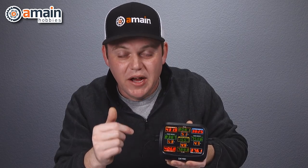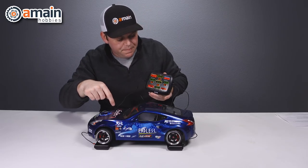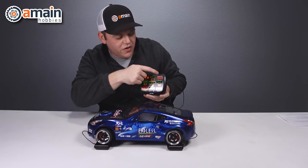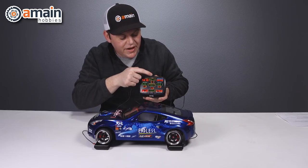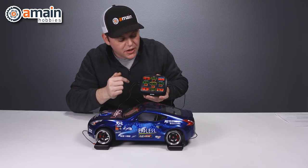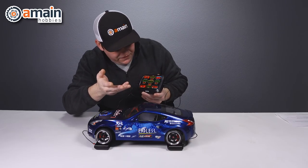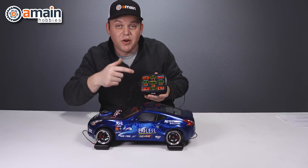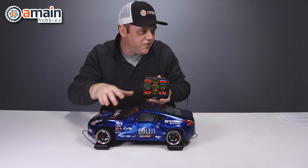As you can see, we have a lot of information on our hub. The center screen in yellow is going to be our total weight altogether. Then we have our corners — each corner display on the hub shows what that particular corner weighs. The top one here is the front right, down below is the front left, then the rear right, and down here is the rear left. We have our left and right weight biases in grams as well as a percentage, and also the front to rear weight bias — the rear weight is about 758 grams and the front is 838. So this model has a lot more weight in the front, with 53% of the weight in front and 47% in the rear.